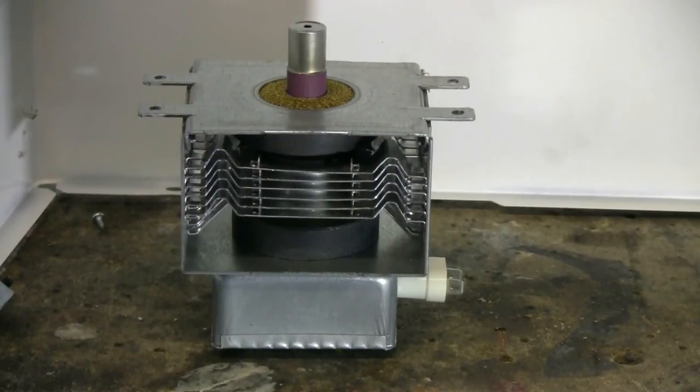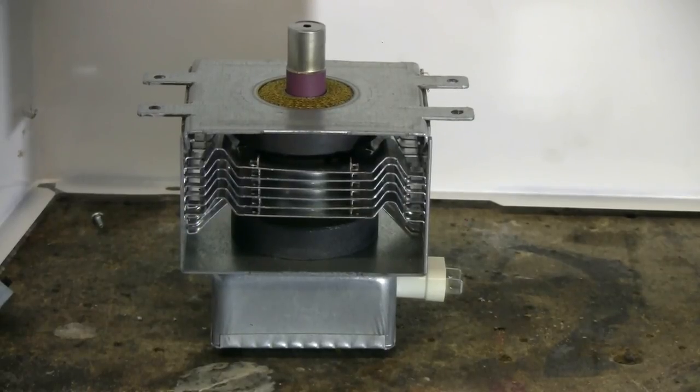The magnetron is one component that you shouldn't really hook up and attempt to power up and play with. Microwaves can be quite dangerous and unpredictable. The high voltages are also lethally dangerous. Basically, unless you have microwave detection equipment and understand how to shield against microwaves, it might be best to not fire the magnetron up. Just take it very carefully apart for the two useful ring magnets that are in there.